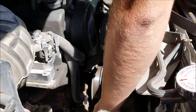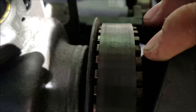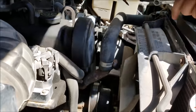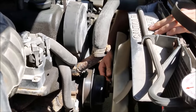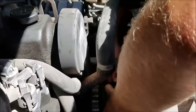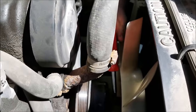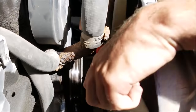We're going to attack our thermostat housing. Our timing belt is completely hashed - this isn't an interference engine but I'm going to change it anyway, it's just good practice. First we need to get our fan off so we can get our pulley off and get to our thermostat housing and timing cover. Kevin came up with a pretty ingenious way to loosen those fan bolts - he kind of dogged it with his screwdriver and then could get on it with the wrench to loosen it up.